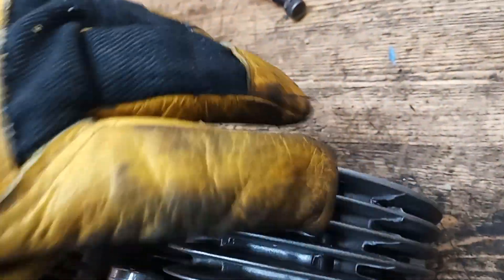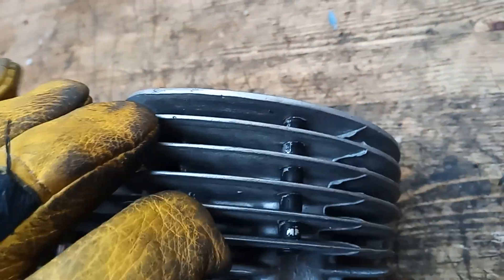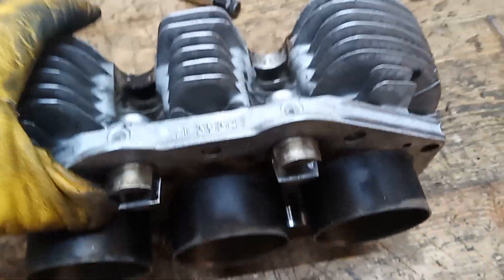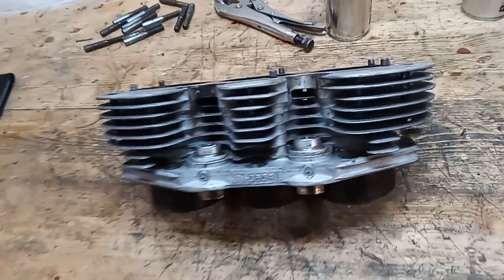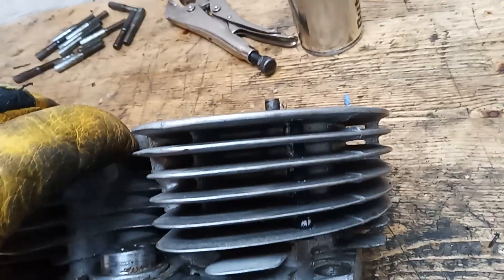There's one thing I've found: looking at these rubber sticks that go through the fins - they're anti-ring devices that stop the fins from ringing and resonating when the bike is riding. If you look, they've got silver on them. I think what's happened is someone decided rather than take all the barrels off and get them blast cleaned, they used some silver paint - which is quite common. People want the bike looking good but it's a massive job getting everything apart for blast cleaning, so they just put a bit of silver paint on. I think that's what happened at some point in the bike's history.